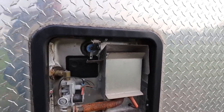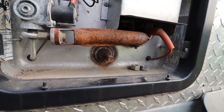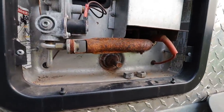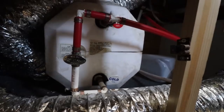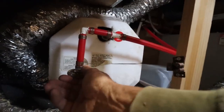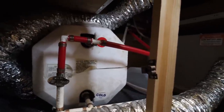I just messaged the guy I got it from — he hasn't got back yet — but I've never seen one of these that looks like this. Usually you put your wrench right here, and I always remove that when I winterize it, but I'm guessing they had to do something different. This nut and this nut go on there together and then you put a wrench on the farthest one in to remove that. I'm just going to leave it like it is and turn on the water. I did the bypasses inside — this one here was open, this one was shut, and this one was shut — then you drain the water heater and run your antifreeze through it. Now I shut this and these two are open so cold water goes in and hot water comes out. This is probably the easiest bypass to get at that I've had in any of the campers.